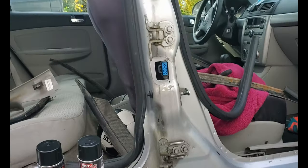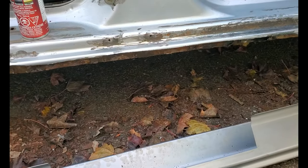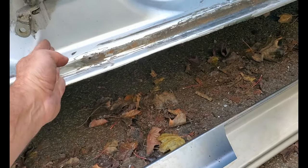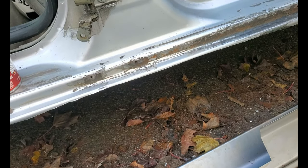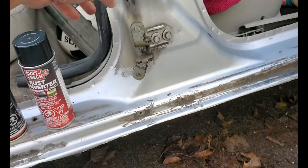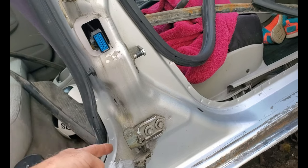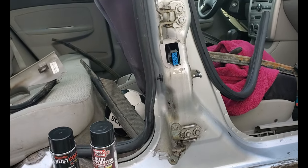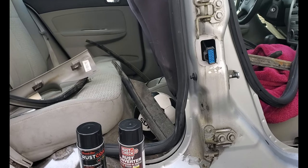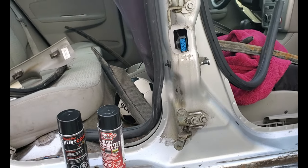The back door is missing — I had to take it off because you can't get this piece up over this lip with the bottom of the door sitting there. There's a little closer mechanism here, a 10mm bolt, just a boot with a simple plug connector. Four 10mm bolts on the hinges and the door comes off. Pretty simple, pretty straightforward. There's a good outline of the hinge on the door, so when I bolt it back up it should just fit right into place.